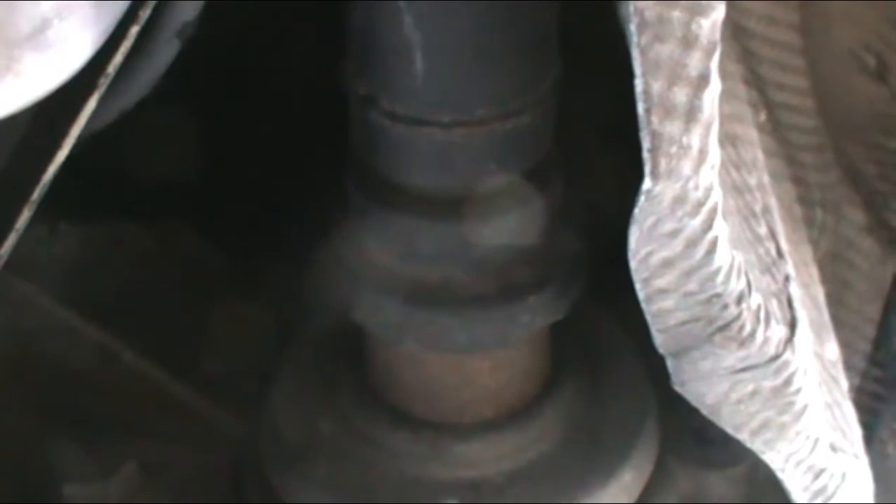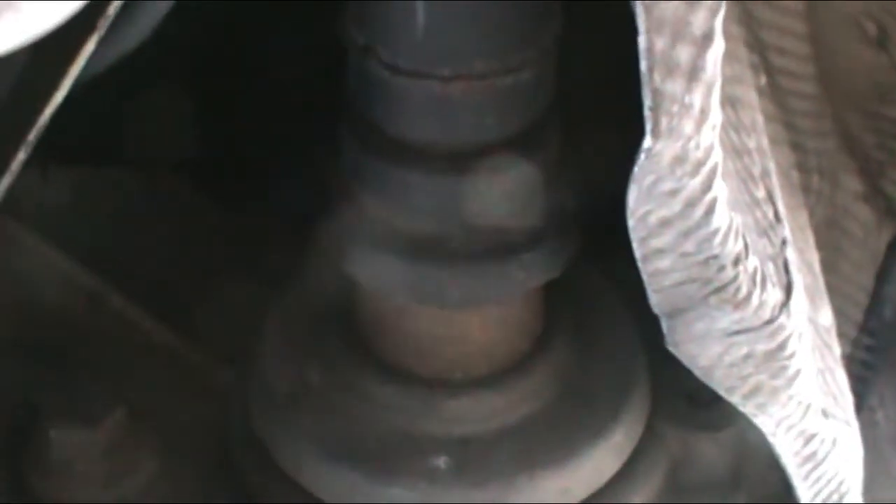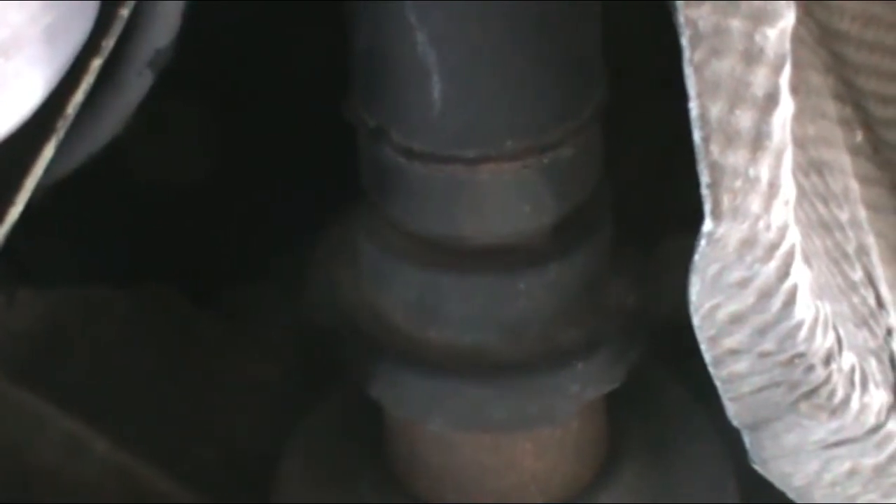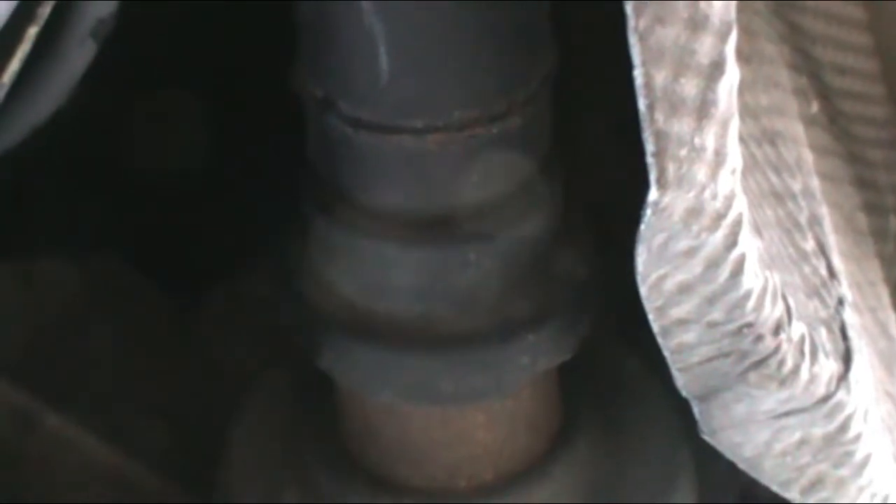What I got is the one-inch extension, so I'll be cutting right before that weld right there, and welding on the new one-inch longer spline front shaft piece — or rear, whatever you want to call it. So now we're just trying to get it out.